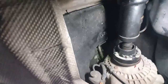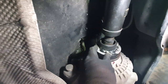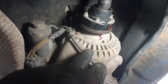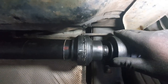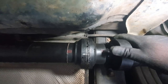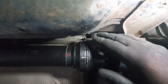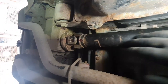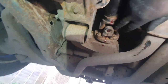So there you have it guys - front coupling to the transfer box, six E12 Torx bolts. Centre of the vehicle, that's the bearing we changed, two 13mm bolts one each side. Then the coupling joint that we knocked on with the hammer and silicone sealed. That's all dry and cured off. Moving towards the back of the vehicle, there are our four E14 Torx bolts, all done and checked by hand. Hope you found this helpful guys.